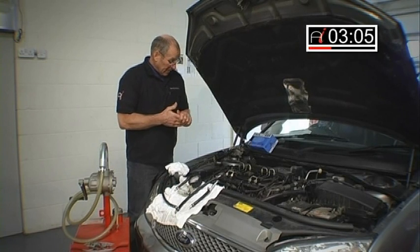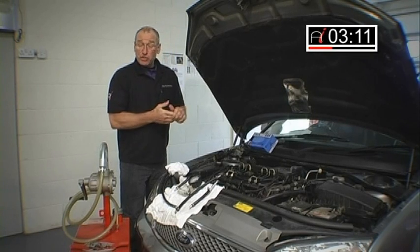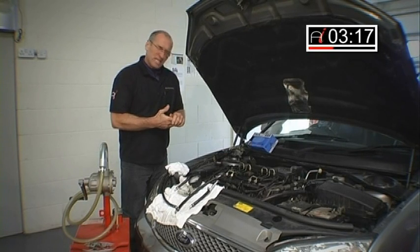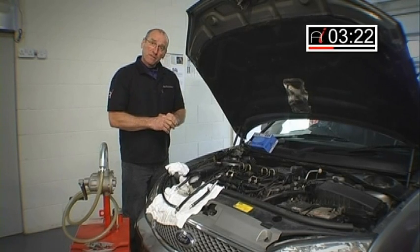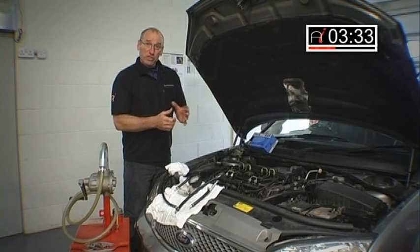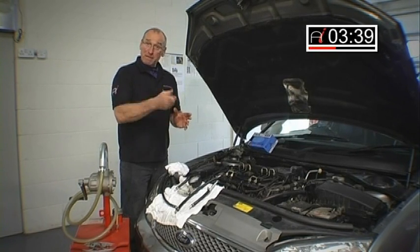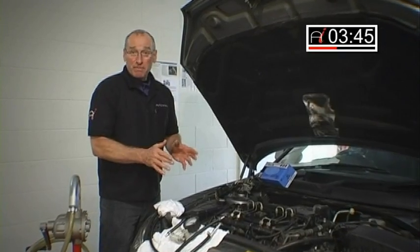So what do we need to do? Simple servicing — a brand new filter has been fitted. It's been suggested you can soak the filter in diesel to fill it; I have no objection to that, but it is rather messy and a bit cumbersome. So we decided to fit the filters dry and remove the pipe which goes from the filter to the high-pressure pump. This particular diesel injection system, which is a Delphi system, draws the fuel potentially under negative pressure — albeit only slight — from the tank. In other words, there is no positive feed from the fuel tank, so we can't prime this by cycling the key. Some systems you can, obviously. So this is a negative pressure system and therefore it has to be assisted.